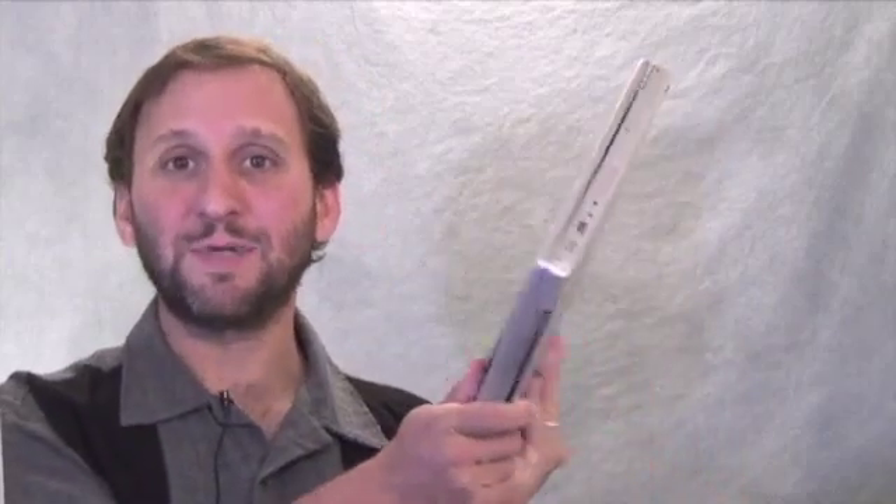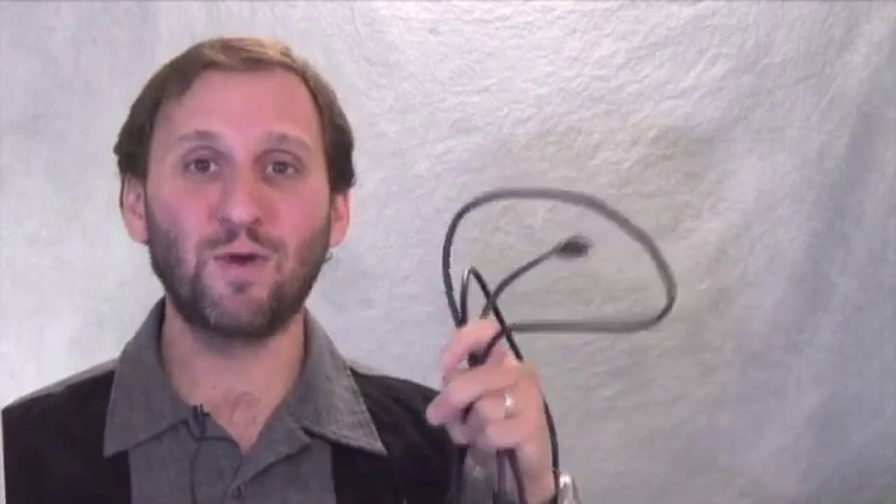The first thing you need, of course, is a second Mac. Say it's a laptop and you want to transfer files to or from it, and you've got your first Mac — in this case maybe an iMac. Next you're going to need a Firewire cable that matches the Firewire type your two computers use. In this case both use Firewire 400, the old-fashioned rectangular connector. If you've got newer Macs you may use Firewire 800, and you can also get a cable that goes from 800 to 400, so you can use Firewire Target Mode regardless of which type your Mac uses, as long as you have the right cable.